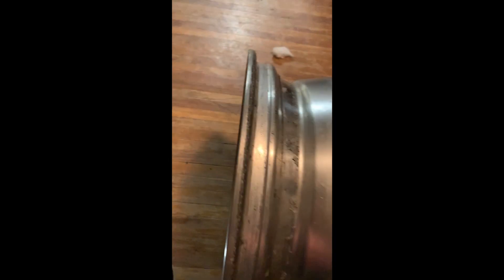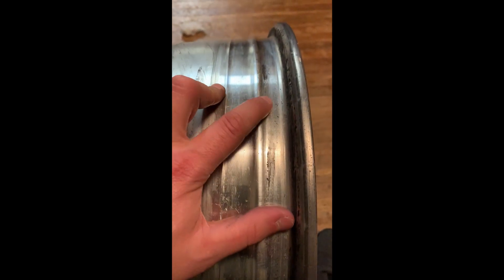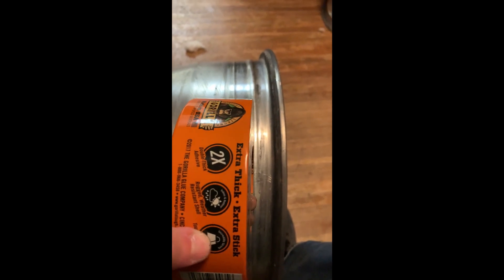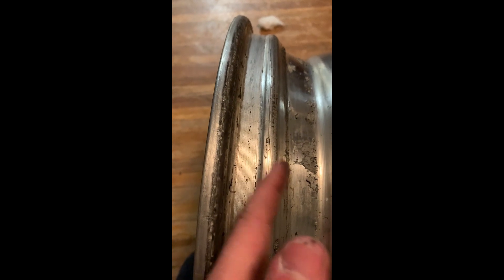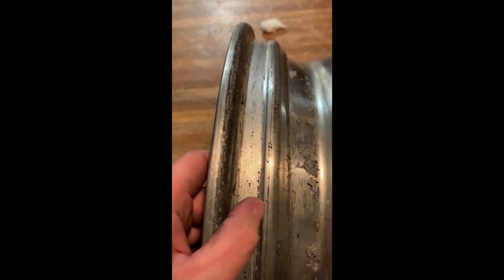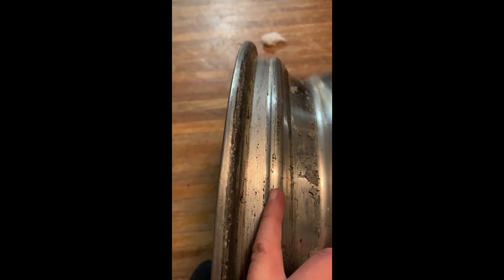So the way I've done it before — as you can see, you have this little safety bead with a little edge on it, and then on the inside of the wheel you just have this little roller bead. The way I typically do it, you can kind of see — shiny, not shiny where the tire touches, not shiny again. I take the tape and I just try to split that hump basically, and I do three or four wraps, usually about four, just going along. Once I get my four wraps down, I lay the tape all out. Then on the outside of the wheel, I kind of feel with my finger right where the edge of the wheel is, the edge of that bead, and I do four wraps and make it taller.